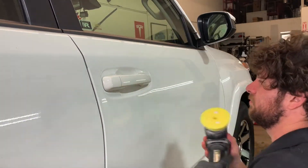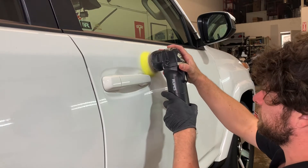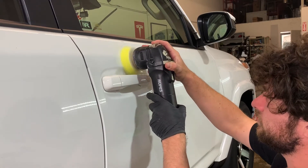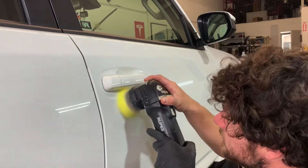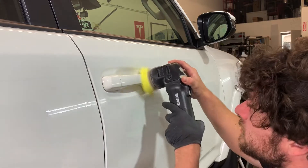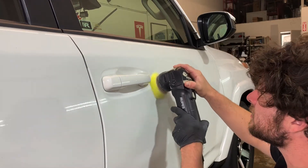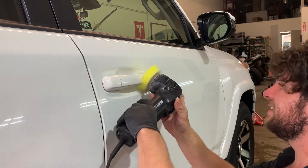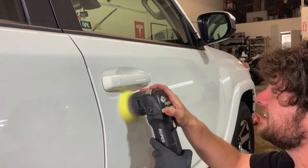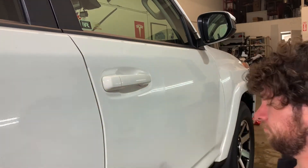Once you've cut it, we're gonna go ahead again and polish it with the foam pad. It is harder to keep foam spinning on some of these machines sometimes, especially the small ones and especially going around the door handle, so just do your best to keep the pad spinning while getting as close as possible. Usually even if you just barely brush against where you need to get, you'll end up cleaning up that DA haze left by the microfiber.